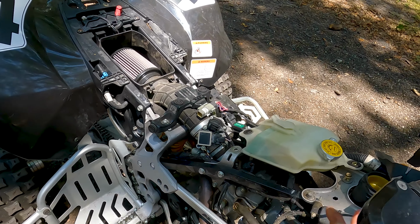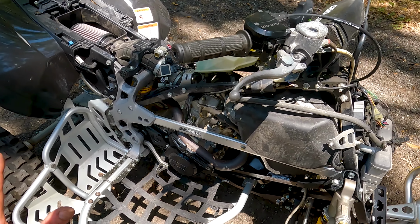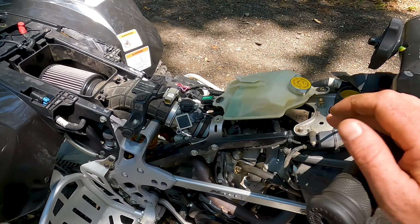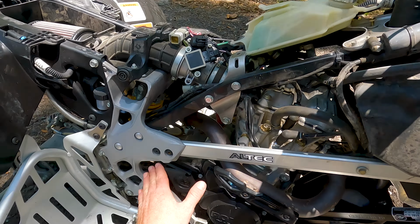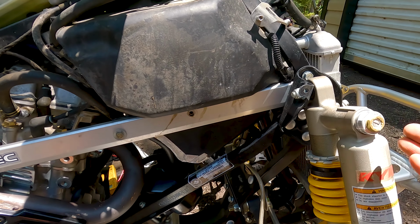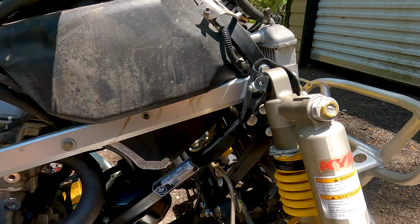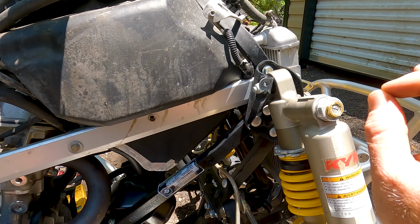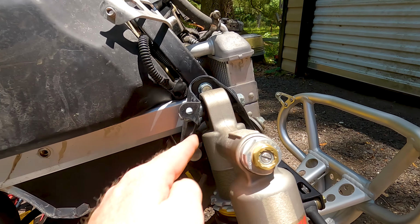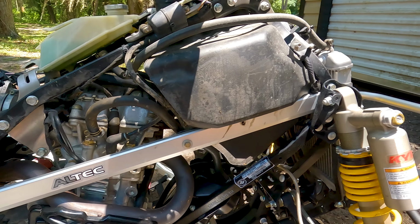unless you really want to tackle the quad, you could take this off up top, but it'd be a lot more work. But the simplest way to take this tank out would be to remove this guy, which, oh, there's only two bolts there, not a big deal. But in order to get to this one, I'd have to take my shock off, unless I bought a very thin specialty Torx 30 to slide right between there, which, good luck finding that with our supply disaster.